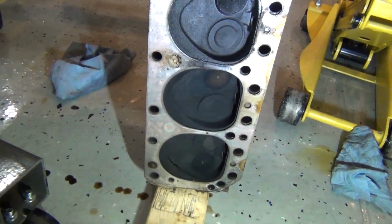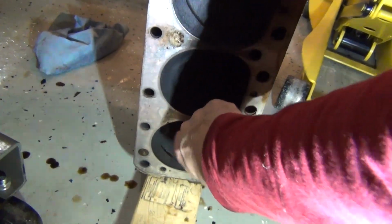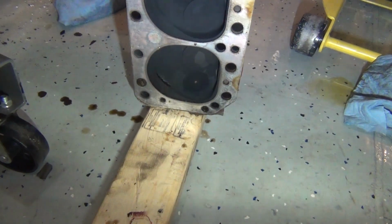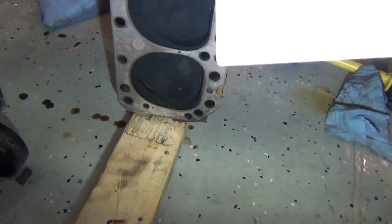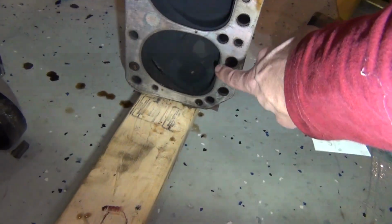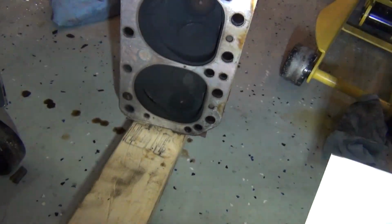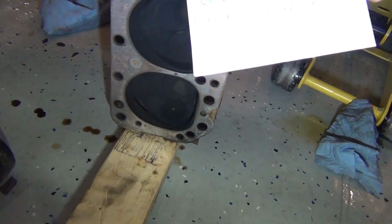If I remember right, I had pretty bad sealing on nearly all of them, but 2 of them. Let's get our little piece of paper. Number 1, I had a 13% loss, and number 2, I had a 13% loss. So they were pretty much sealing all the way around, and probably the losses I was having were the actual valves not sealing good or blow-by on the rings. Number 3 was shot. We know 3 and 4 are both shot.